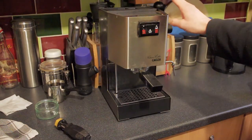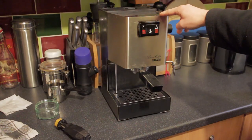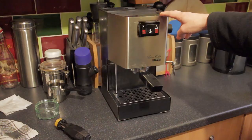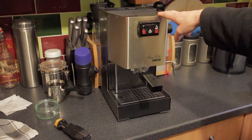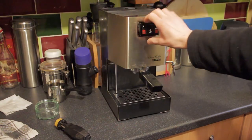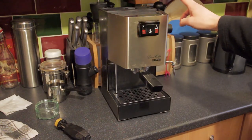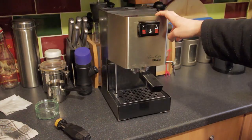In this video we're going to be looking at stripping, removing and descaling a Gaggia Classic boiler. This is my machine and it's something that hasn't been done since I've had it, other than general flush throughs. More recently the temperature at the group head has been dropping, so it's possible there's a bit of scale buildup - even though I'm in a soft water area, this machine was secondhand so I don't know the environment it was in previously.